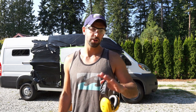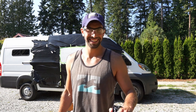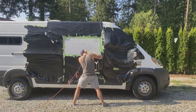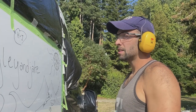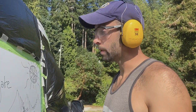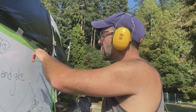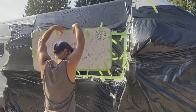We've completely covered the van to avoid getting metal shavings everywhere. Last time we didn't cover anything and got shavings everywhere. The time after that we covered everything but the roof and got shavings all over the top. Now it's fully covered. We ultimately went with a jigsaw because it is safer when working with spray foam, and we're using an ultra-fine sheet metal blade which is giving us a great cut.